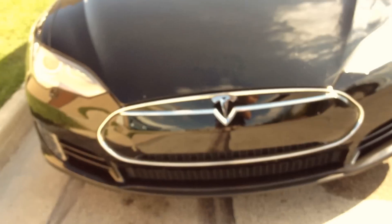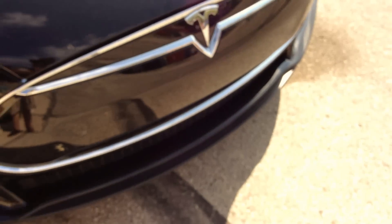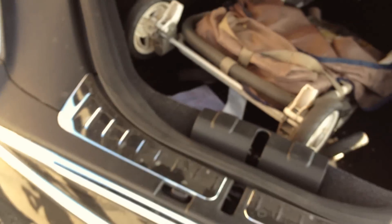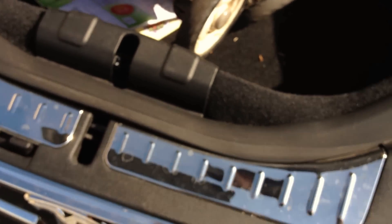And that is how you open the frunk with a dead 12 volt battery. Now, why you'd want to open the frunk with a dead 12 volt battery — if you're too scared to pry off the nose cone to gain access to your 12 volt battery remote terminals, you can pop off this stuff here. Although, I find this is actually harder to pop off and you run the risk of breaking something. If you just pop the nose cone off — nose cone popped off, jumper, and you're done.